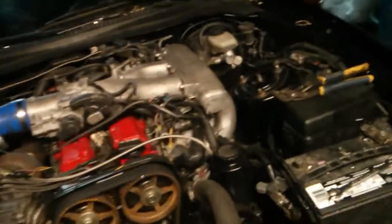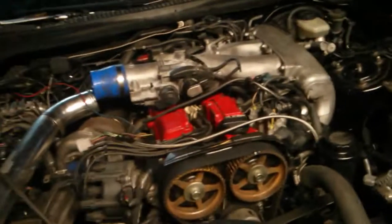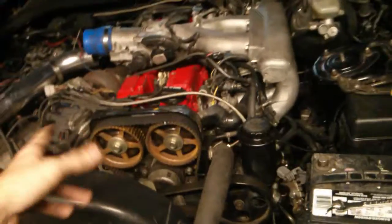If this were my car and I were going to turbocharge it, first I'd get an aftermarket computer, bolt it up, tune it running as an NA car. Then I'd add the turbo and run it with the stock injectors. If you have a bit more money, change the compression ratio, have the bottom end built up — bore it out, get larger pistons, forged rods, lower the compression ratio, put in a head gasket — then turbocharge it, tune it again, and then upgrade the fuel rail and injectors. Do camshafts at any point during the process.